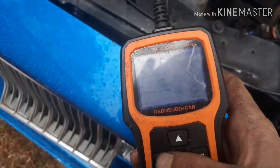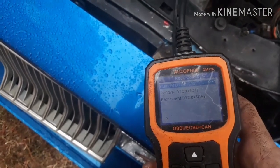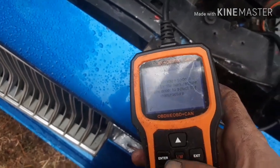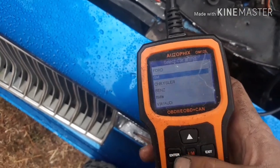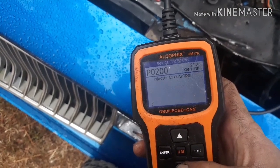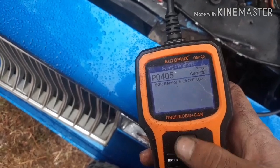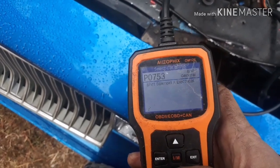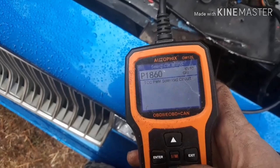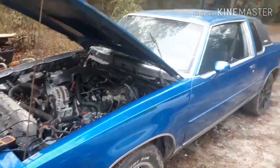I've got a lot of codes going on here — that's because I'm using the Turbo 350 trans with a stock PCM and I'm not running a mass airflow. I was unplugging the injectors trying to figure out which one was bad the other day. I'm not running an EGR, and of course no EVAP, and I'm using the Turbo 350 trans. But that is how you wire in your OBD2 port. Thanks guys for watching — please like and subscribe, I appreciate it.